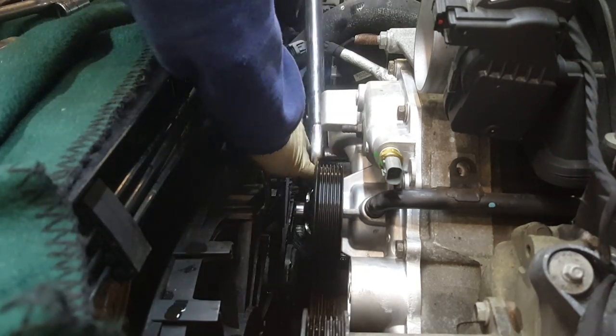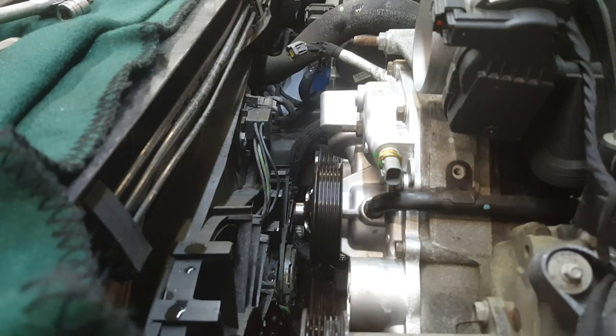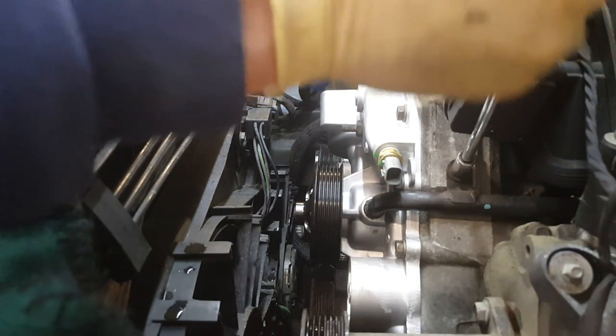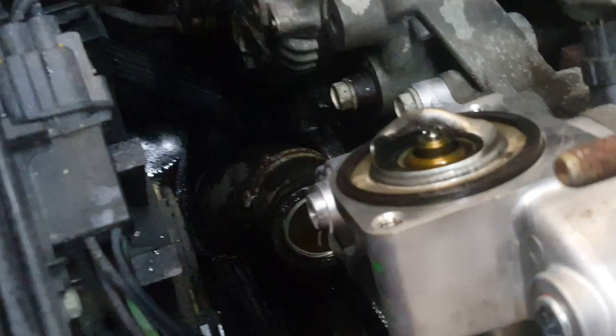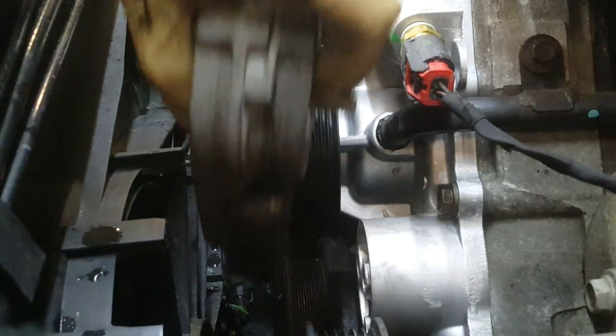You can refer back to that diagram if you need to know the torque sequence. We got that all taken care of. I just pushed in this coolant tube — I usually like to smear a little silicone around the o-ring any time I'm installing a tube like that with an o-ring on it, just for reassurance that it's not going to leak. This one just had an 8mm bolt holding it down. We're going to plug in our coolant temperature sensor — if your water pump doesn't come with one and you have to transfer it, just make sure you use some thread sealer on that. We're going to install our thermostat big side down, then our coolant hose. I just have my channel locks on this spring clamp — on a lot of vehicles you won't have the space, and you will need the special tool for those spring clamps.